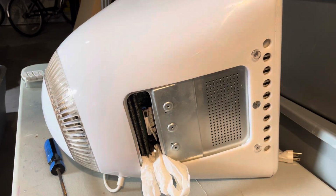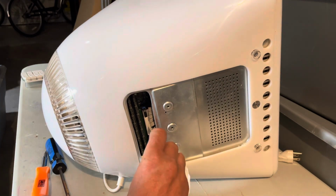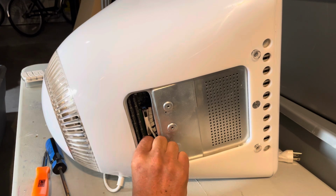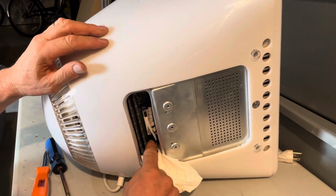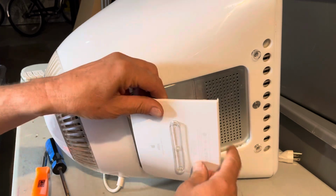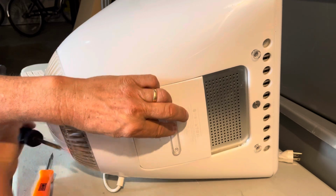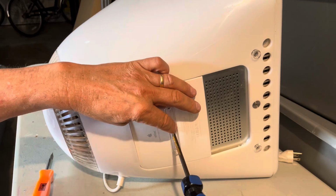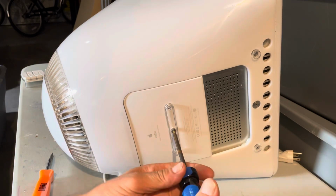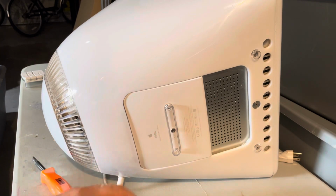So then what you got is pretty simple. Get your new battery. And I'm gonna just put the negative side in first, and then push it back in there. Pull out your tissue paper. Put the bottom panel back on. There you go, and you're done. So that's how you do it. Real simple process. And you saw right there for doing RAM, it's pretty simple too.